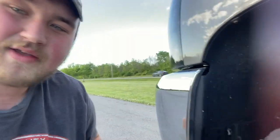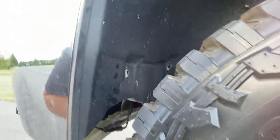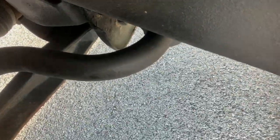My dad went up my driveway full lock and went about 10 miles per hour into the driveway. So right here — I don't know if you guys can see that — but you have to cut out a notch in the fender liner so the wheel can turn. And back here there's no rubbing at all. It does not rub full lock either way. If you go to full lock, you can see ever so slightly it hits the sway bar, but that is like ever so slightly — you don't even notice it.